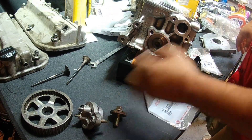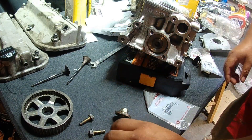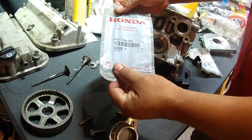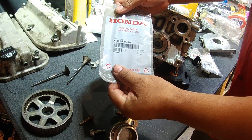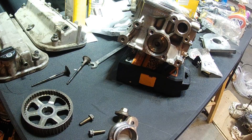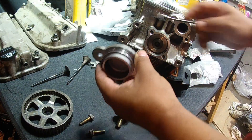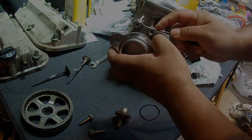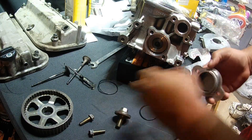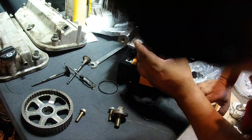Here's the o-ring for this side right inside there. Since I'm going this far deep into it, I'm actually going to replace these seals. This seal — Honda part number 91301-P8A-A00. Cut this open and just make sure you don't cut the seal when you open it. Next, get this old one off. I found a pick — go ahead and pick the old one out. Be careful not to mar the aluminum. Yeah, that thing's rock hard. It is keyed, so it only goes in one way — kind of hard to screw it up.